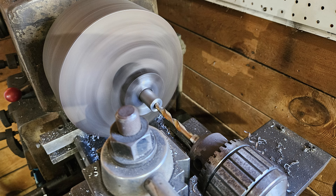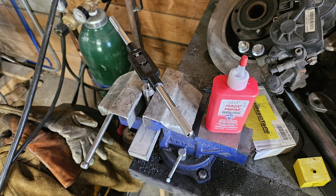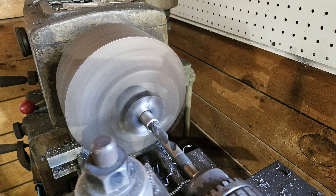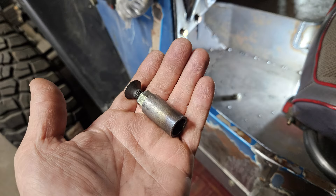What I ended up doing was just making a little adjustable throttle stop. I started with a piece of three-quarter inch solid round bar and just drilled and tapped that for a three-eighths bolt with a locking nut that could be used as an adjuster, so I didn't have to get the length just perfect and can tweak things. I turned that piece around backwards and then hollowed out the backside so it wasn't like welding three-quarter inch solid bar to sheet metal — now it's about sixteenth to eighty thousandths wall three-quarter tubing where it meets up with the floor. That's a lot easier to weld, and it was a booger to weld anyways just because it's super cramped in there with seats, pedals, steering, and everything else. I did get it into place — it's heavily tacked and half welded.